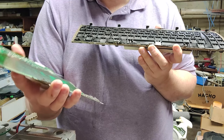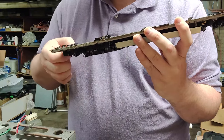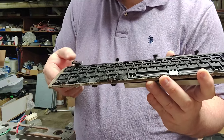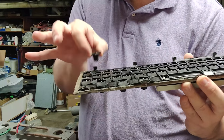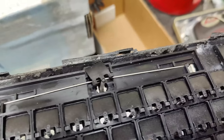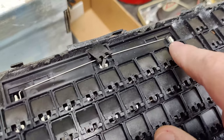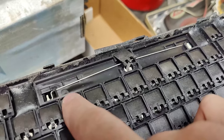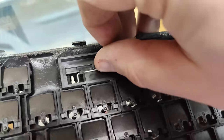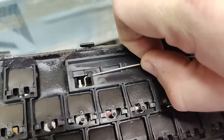There's a piece of plastic below that, and then you have all these inserts. Each key is its own individual mechanism with a spring, a flapper, and a barrel, all sitting on that foam sheet. The foam sheet in this one is basically disintegrating. The space bar has a mechanism — when I took it apart, I did not take the space bar off because it has a metal mechanism and spring, and it's easy to accidentally break the little clips. So you've got to install the space bar before you reassemble.